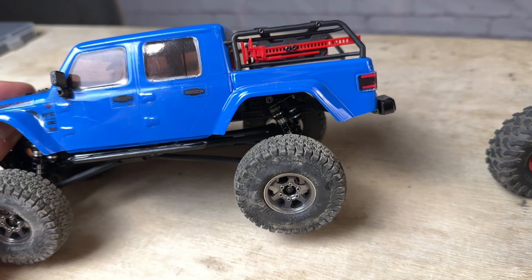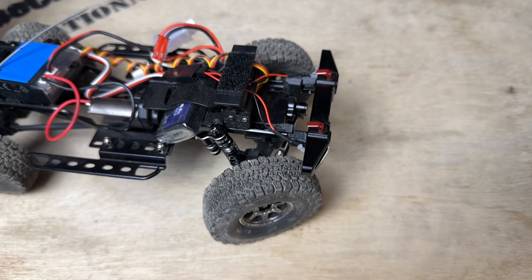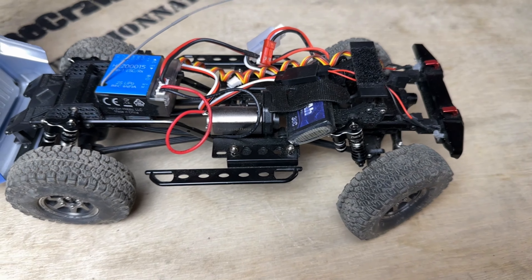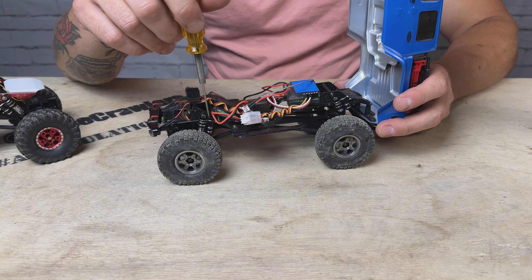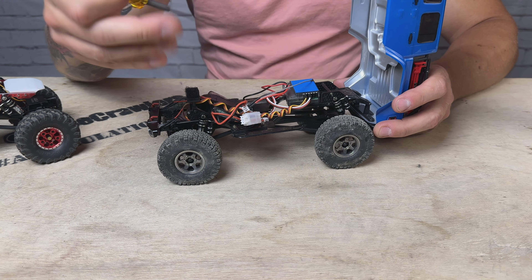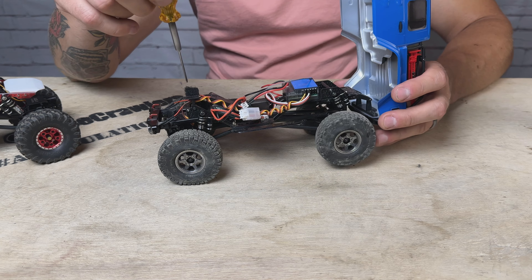I'm running flex extensions on these front and rear, and also the Grizzly Works chassis setup, so this is not a factory setup. A couple of installation notes: if you're putting this on a factory chassis, Nex Racing doesn't supply any hardware, so you'll have to supply your own. You might also need some shock spacers to bump these reservoirs out from the chassis. Because I have flex extensions, they come with little shock spacers. Without that, you might run into binding issues with the reservoir and shock body hitting the frame. If you do run into binding issues on a stock chassis, that could be your root cause.